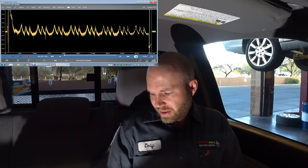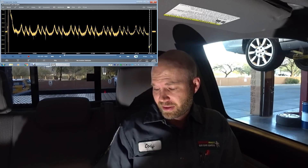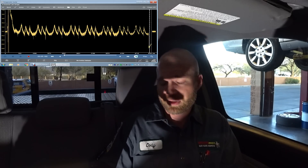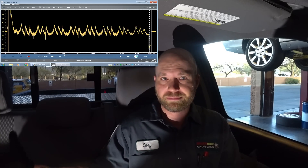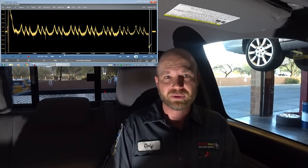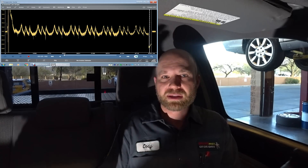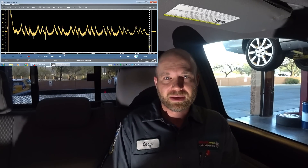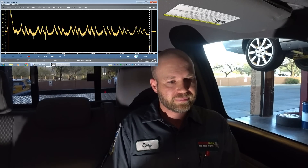You can see we have peak one, peak two, peak three, and then we have a valley — a missing peak. This is a four-cylinder engine, a 2.7L Toyota. In just a two-minute test, we've verified there is a cylinder that needs further investigation. We don't know which cylinder without a second channel trigger, but being right at the DLC, this is nice for a quick and easy setup.